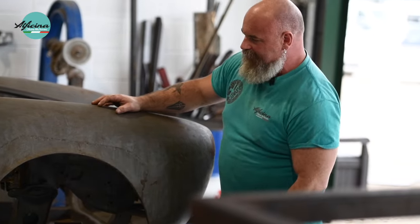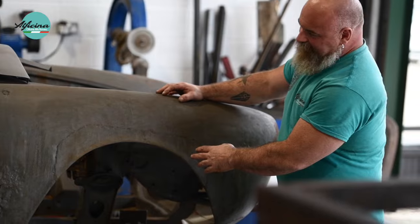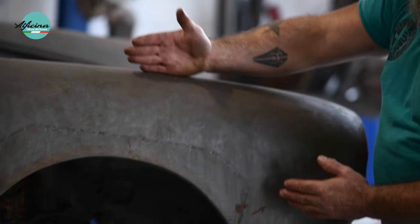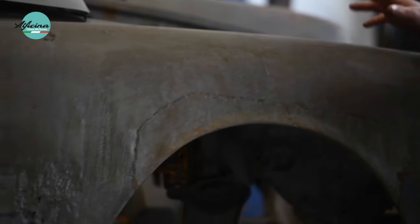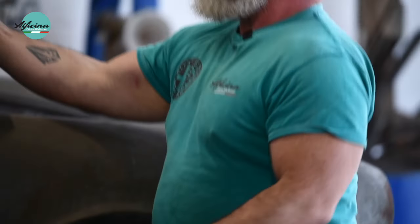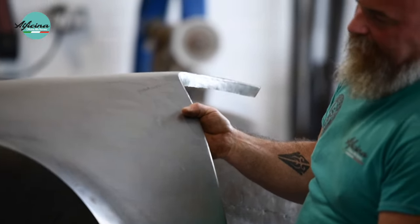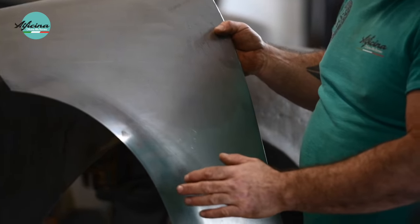This has had a lot of repairs in its time as well, a lot of damage repairs, a lot of rust repairs. You can buy these wings, but we're not going to replace the entire wing — we're probably going to section the wing up to the top central section and replace just the bits that are actually damaged, so we don't need to disturb too much of the car. This is the start of a section of the wing for the other side — you can see we wheeled it in the English wheel, edged it to the door pillar and then started doing the backward curve to mimic the flare that's around the wheel arch.